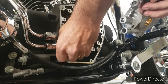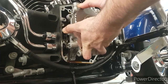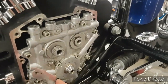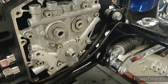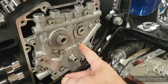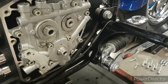I like to run the drive sprocket on there when I'm putting the cam shafts back into the cam chest because it allows you to rotate the cam shafts a lot easier. You can see there it's turning free. We've got to get these bolts tightened up on the oil pump — there is a sequence. You have to rotate the back wheel so you get the crankshaft spinning, that centers the oil pump on the cam plate and the crankshaft. Then you nip up the bearing and tighten everything up. There is a sequence for that, so check your manual.